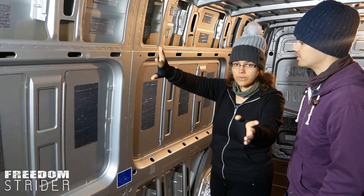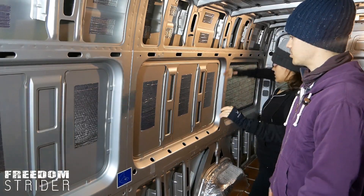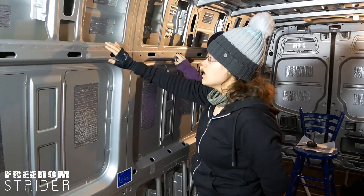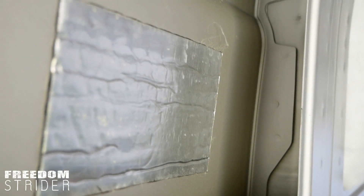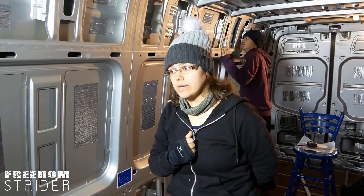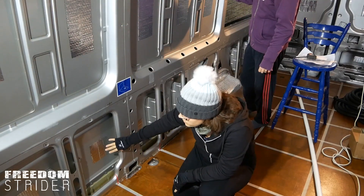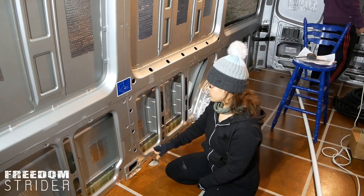So the majority of wires are gonna go down this wall, because there's no pesky door in the way. A few issues with running wires all the way down through the cavities - there's actually solid beams here. I've seen people drill through them with holes, which I guess is an option, but it's a bit tricky and I don't know about the structural integrity of that. In the wooden cavities you have more depth because, as the van climbs, it becomes narrower, so you have more space here for the pipe, but you still hit the wall there.